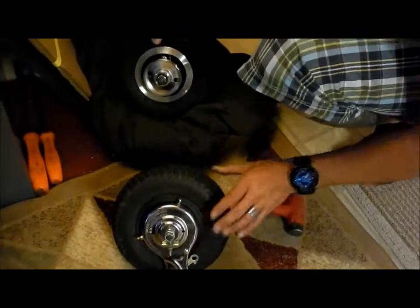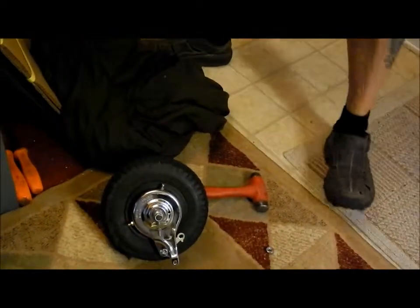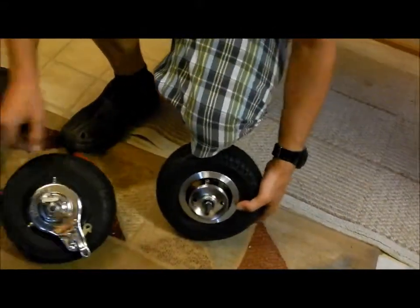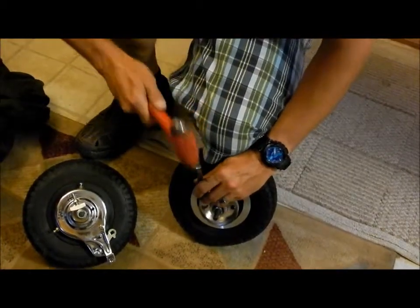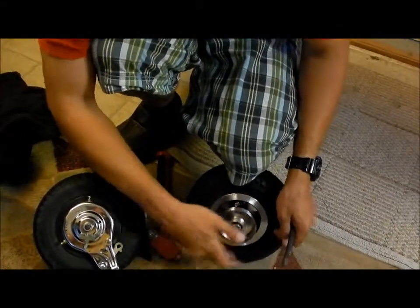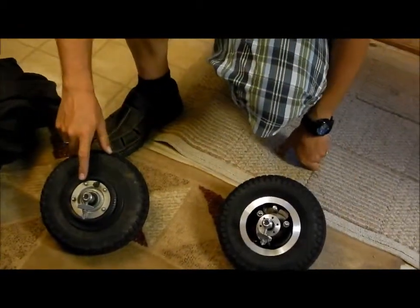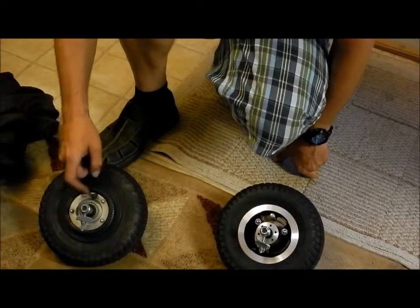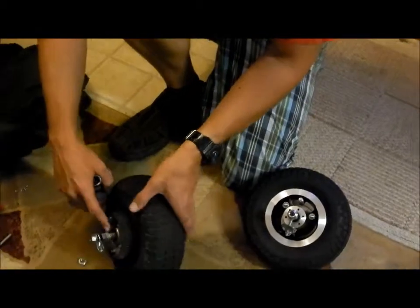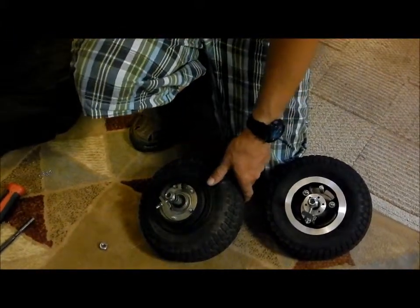In order to get your wheel apart on this Cobra Gas Scooter, you'll have to take a punch. Pretend like this aluminum wheel is the factory wheel. Once you have the brake shell off, in order to get the inner brake off, you can take a punch and drive your brake drum counterclockwise until your brake comes off. But sometimes it's near impossible to get the sprocket off simply by using the punch. So we've developed a new tool at ScooterR.com — you set it down over the nuts and impact that sprocket off. I recommend anybody with a new gas scooter have that tool.